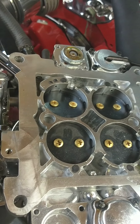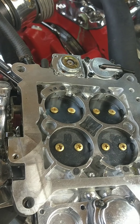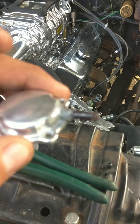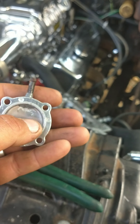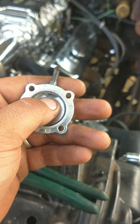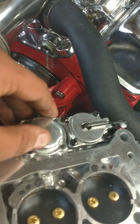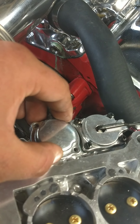So I guess I'm going to get it all stuck back together and we'll see how it does. Well, hindsight is 20-20 — this guy here can't be sticking out inside the cup. It was out to about here, so I used a die grinder and a burr bit to take her down. Now she actually fits. So let's get her bolted on here — don't forget your gasket.